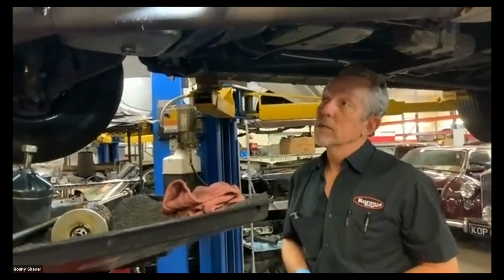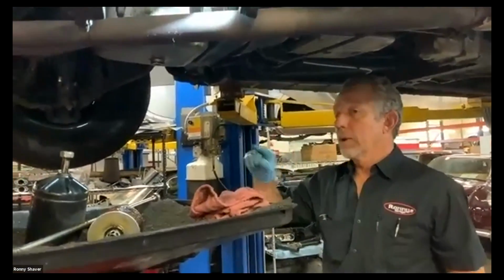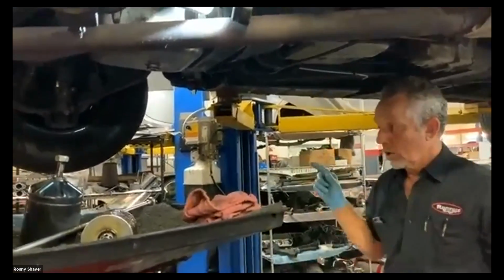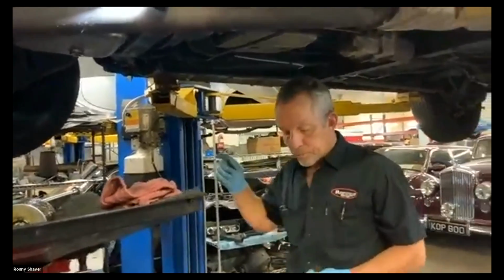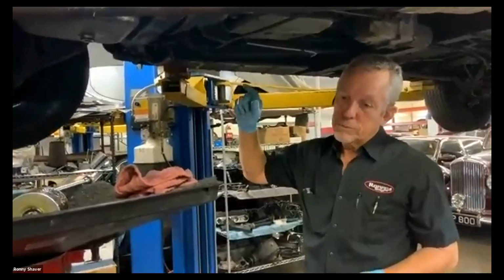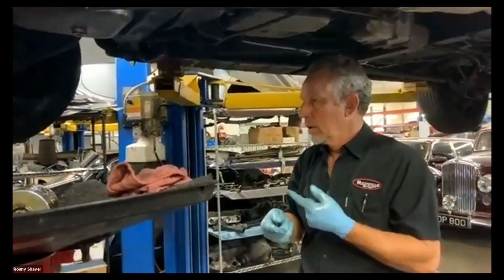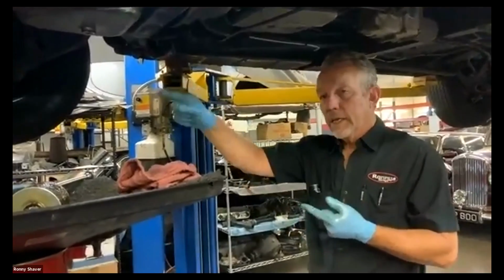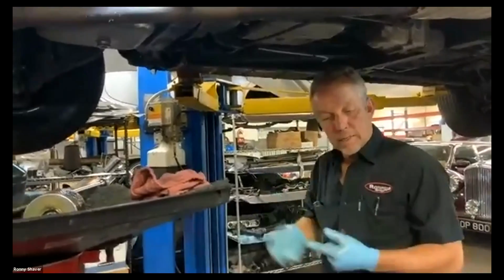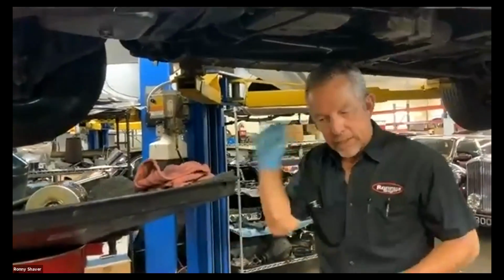These cars, and let me back up one bit. The reason they're worried about those soft metals is that the bearings on most cars are made from soft metals. These cars obviously have the same soft metals in the bearings, but it has a brass gear, or bronze, I think it's brass, at the front of the engine that runs the oil pump. So it always adds more to the oil. It gets in there.